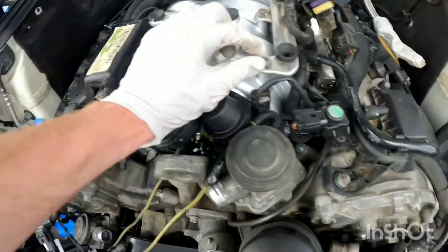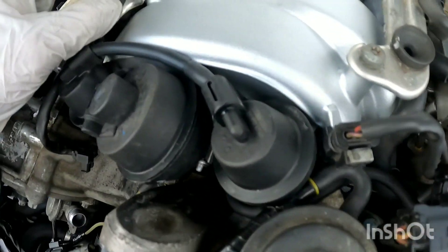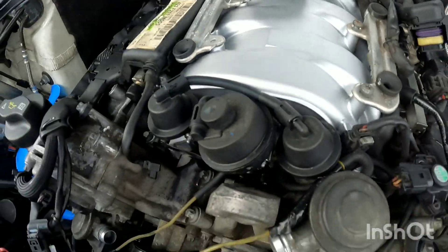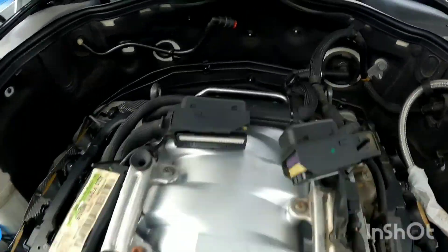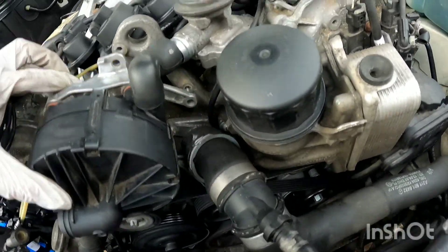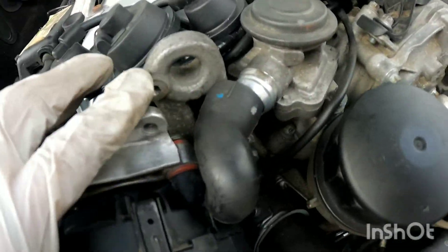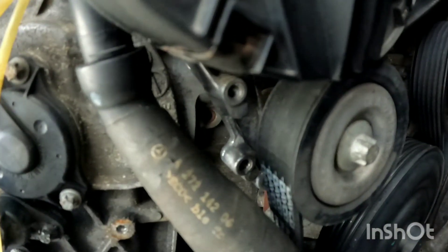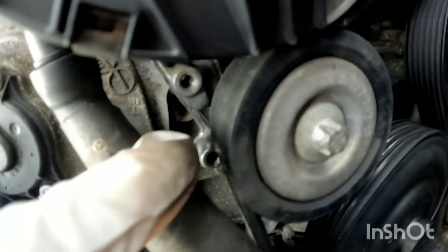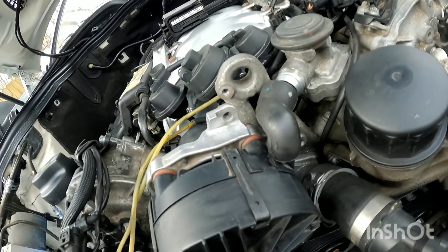After you get your wiring harness in — there are six bolts holding it — we're going to put these pieces in for the ECU. After you get everything in and bolt down your ECU, we're going to put this emissions control piece back in place with these three longer bolts: one here, one there, and one at the bottom. Then get all your vacuum lines connected up there.